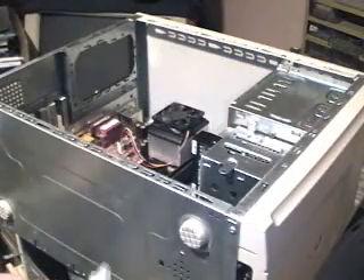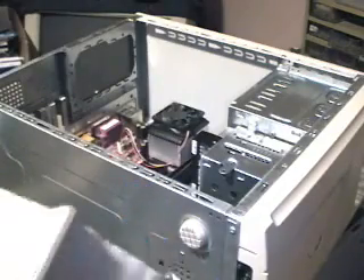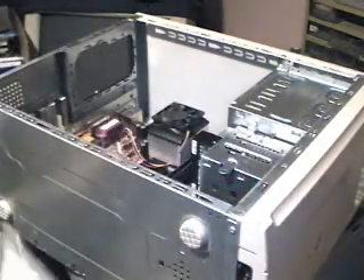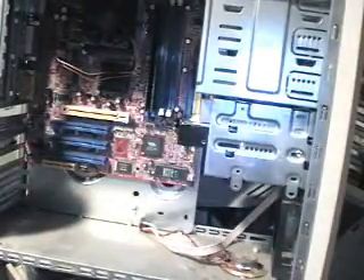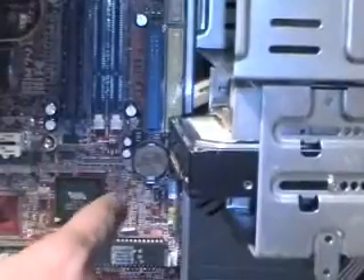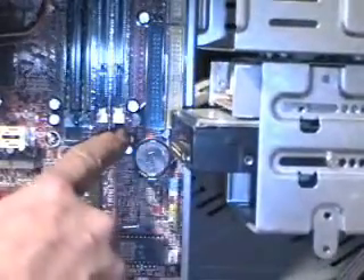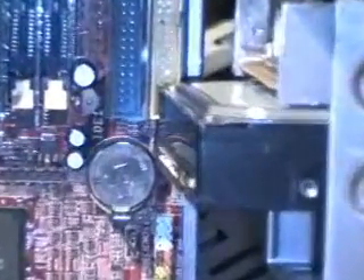Next come your cables. You'll notice one has a blue end on it — this is a UDMA cable, as they call it. Always put this one on your hard drive. Now, on your board, these little connectors here are where your hard drive plugs in, and this one is for your floppy drive. The top one, labeled IDE1, is for your hard drive.